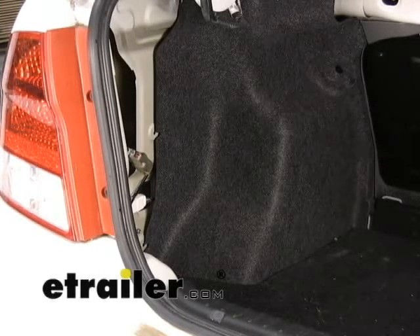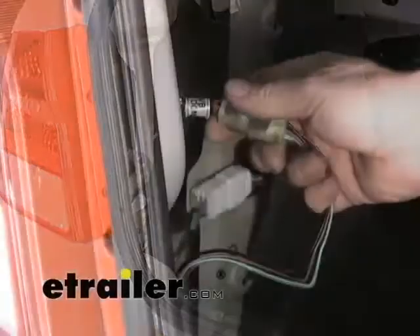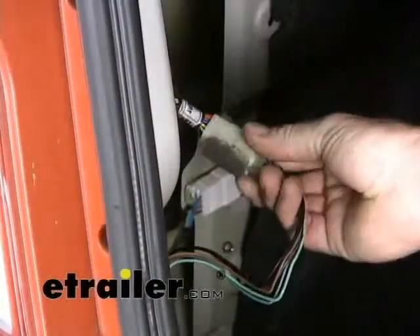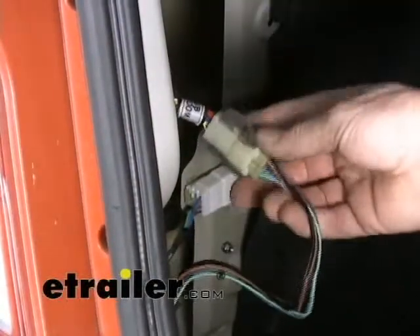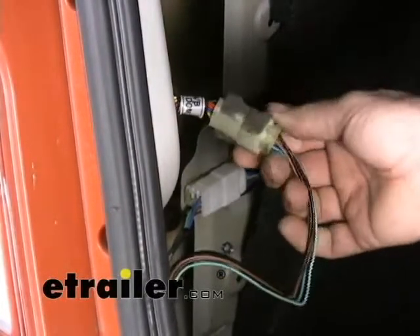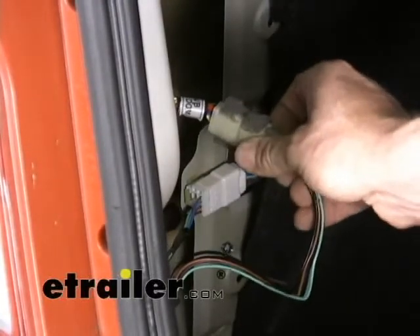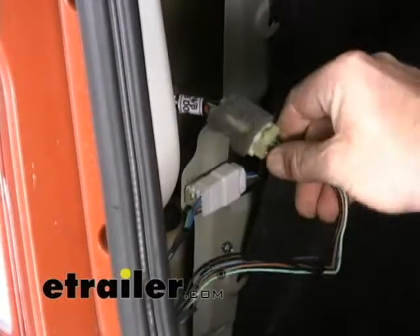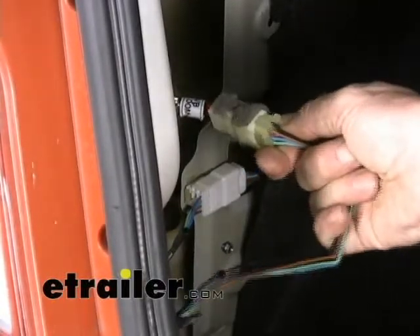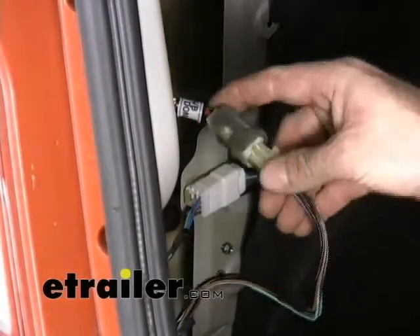On this vehicle, we'll show you a typical wiring schematic and a couple of variants. A typical connection point is where the wiring comes into the back of a taillight — there's almost always going to be a connection point. Older vehicles ran straight, but newer vehicles will always have a wire harness with a snap connection like this. A T1 connector simply fits in between this harness — there's usually a tab you push down to pull it apart, and then your T connector fits in between and your wiring comes off from there.